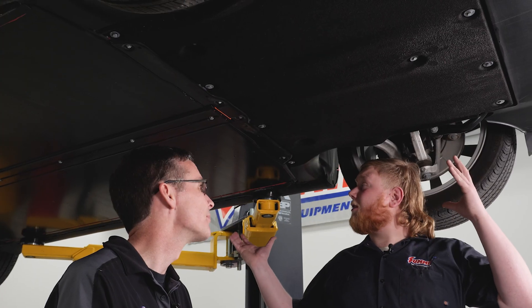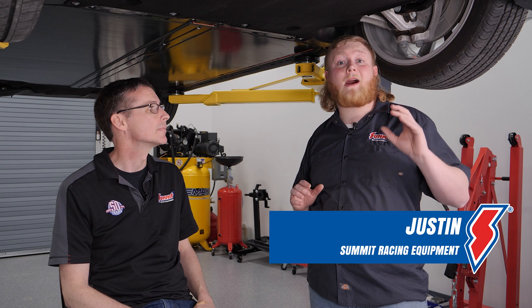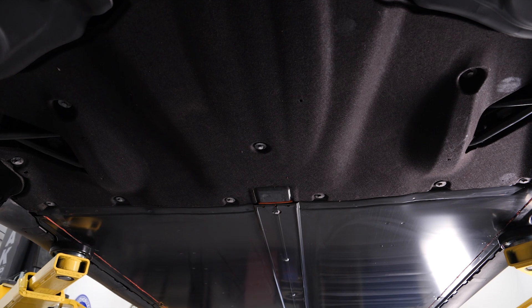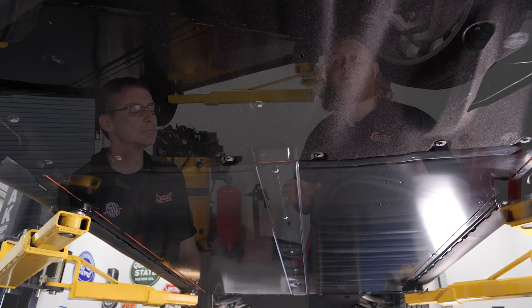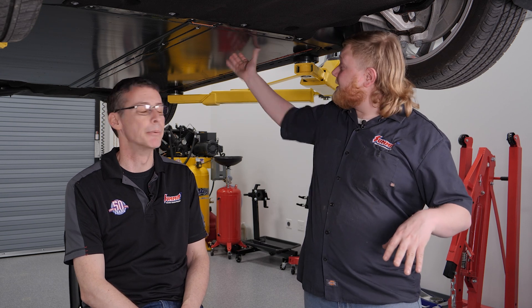What you have under this car is just all aerodynamic panels. With a lot of EVs and modern auto design, it's all about aerodynamics — air flowing over the top of the car is just as important as the air flowing underneath. Everything is sealed up, and this is easy to do with our Tesla because right here are our batteries. You don't have any conventional parts under the car like a transmission, exhaust, or driveshaft to worry about. So it's all smooth panels, and we'll take you basically all the way to the back of the car.